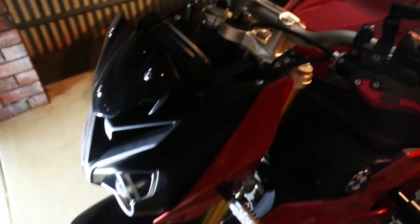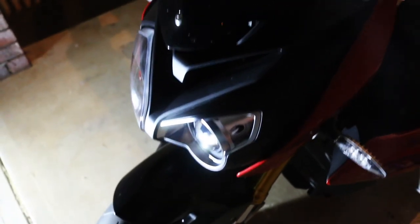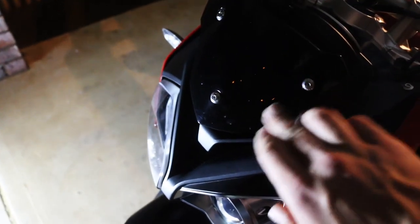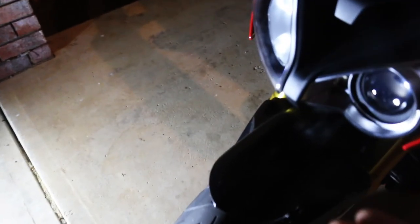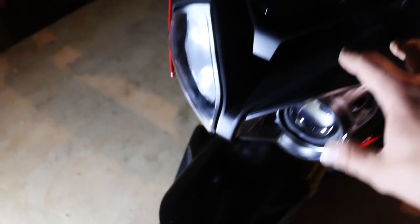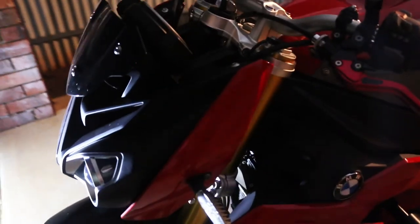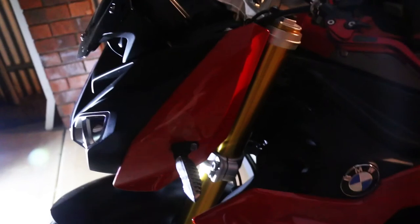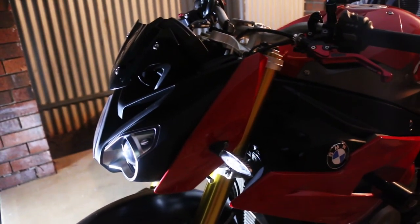To start with, we're going to need to remove this bolt and this bolt. Then we're going to work on getting off these sort of side headlight fairings, and then we'll undo these three bolts, remove this piece, and there's one bolt just under the nose — and this whole plastic piece will come off, giving us a lot more access. The tricky bit is removing these side fairings, so I'm going to show you how to do it without breaking it.